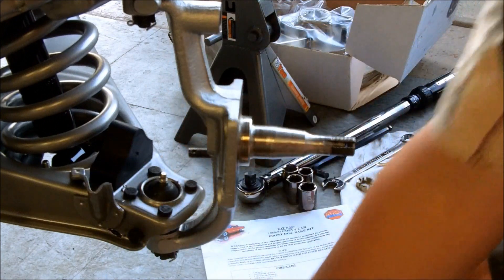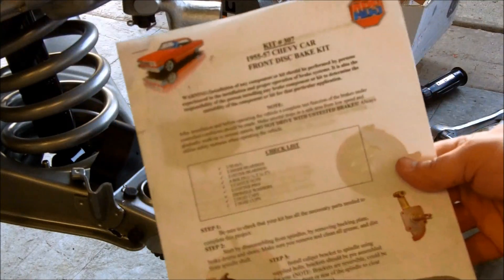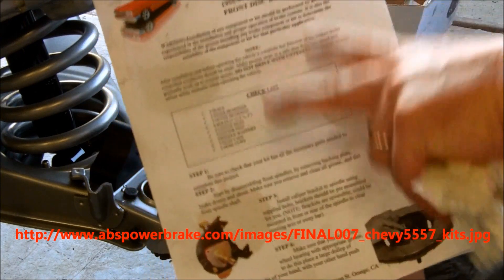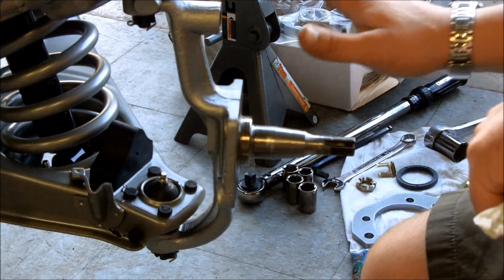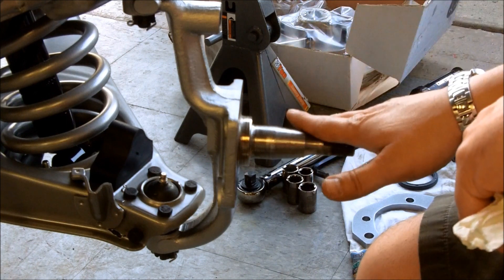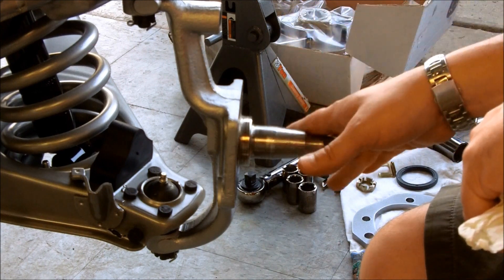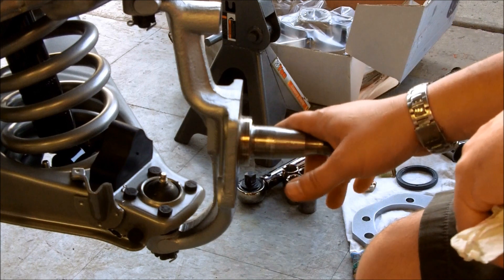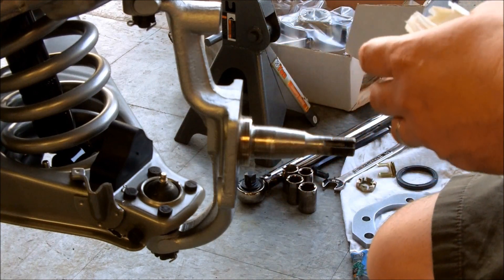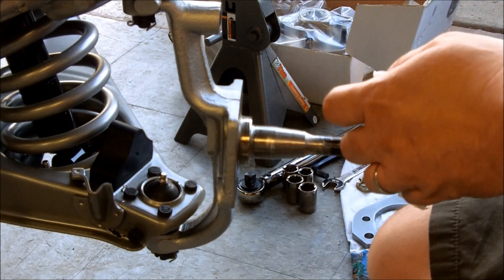Steering arm is off, ready to go, and I've got the bolts out. So what we're going to do now is install this kit — this is kit number 307 from a really good company called ABS Powerbrake, here in Southern California. This is a zero offset kit, which means after we're done the wheel's not going to move out at all like some of the other kits. This kit is made for 14-inch rims, so I can run any rims I want. For those of you that run 57s with stock rims, those are 14 inch, so this kit will work well. One thing about this kit: it will throw the calipers on the front, which is not typically the way you see it, but that is the way the kit was designed.